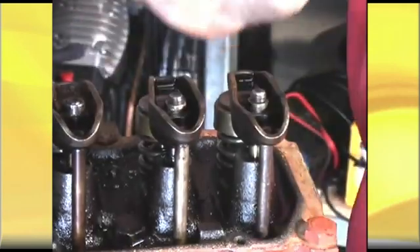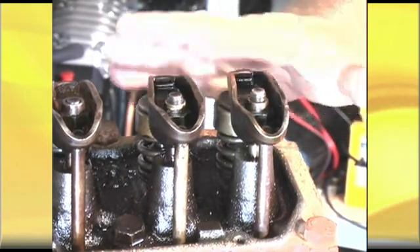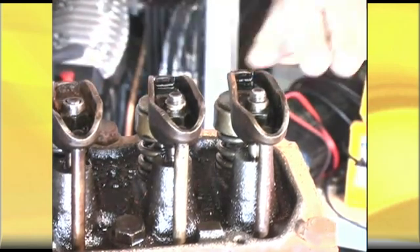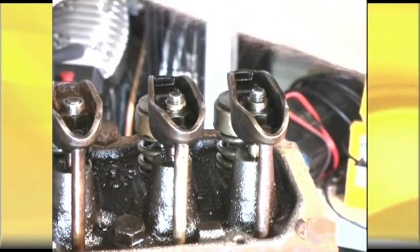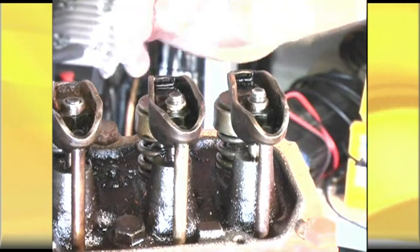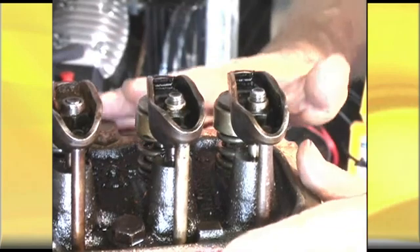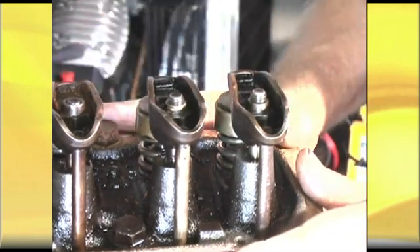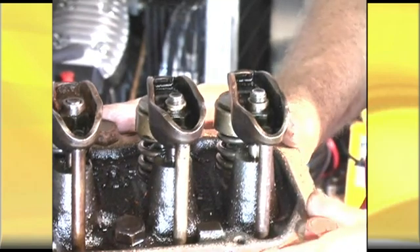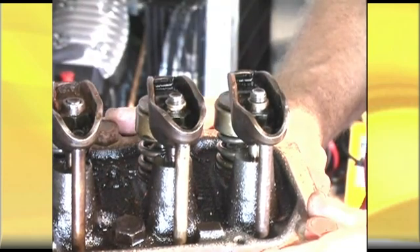And there we have it — that is adjusted. Now all I have to do is get my next cylinder to rock and then do my next pair of cylinders, or if I'm doing the top dead center method I would find out which others I need to do. That is a correctly adjusted hydraulic lifter — as simple as that. The positioning method will depend on your engine and how difficult it is to turn over. I really advise you have a good look at Tech Talk 2, which covers all the positioning methods, before you attempt to do your hydraulic lifters. Thanks for watching and I hope you learned something.